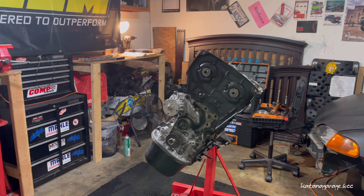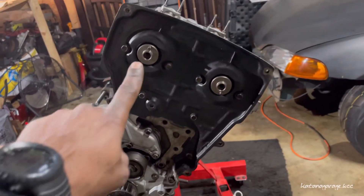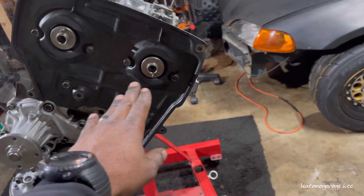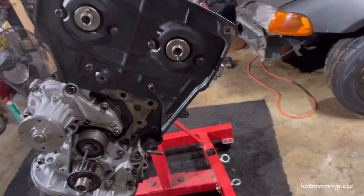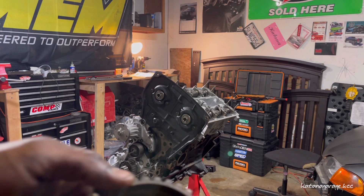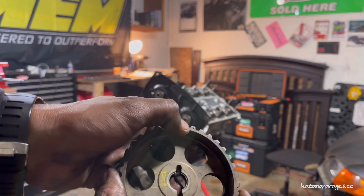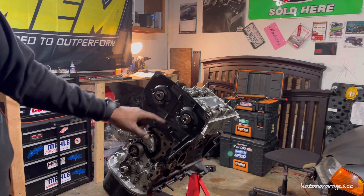So use these notches here — you can see them. This notch here on your intake cam needs to be at the 12 o'clock position. Let's get the cam sprockets installed. How you want to do it is this notch here — this little notch — is supposed to be aligned with this line on the timing case respectively.